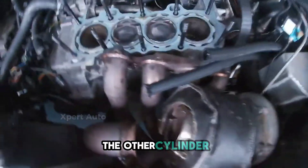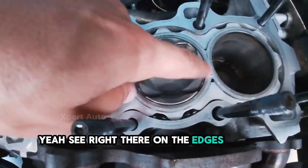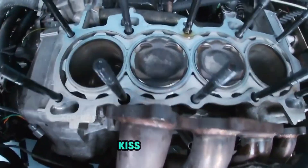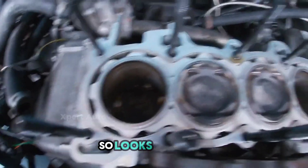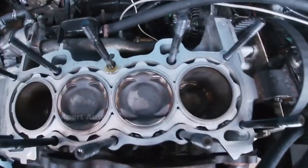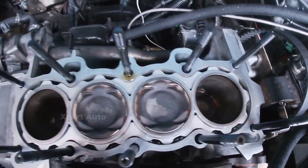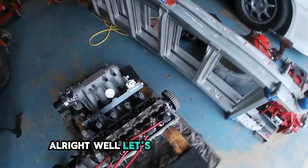There's the other cylinder. See right there on the edges — all the way around. Valves kissed this one here on the edge, again kissed the head. So it looks like every cylinder hit the head a little bit, and then these two the valves hit on the intake side. Let's check the head out.